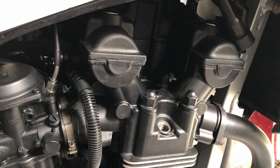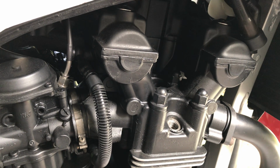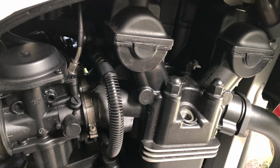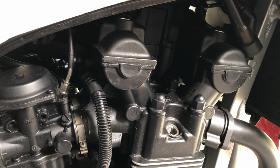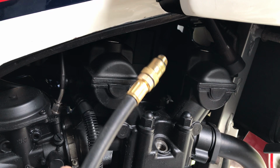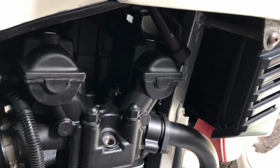Those piston rings were used for 22,000 kilometers, and that's my problem. The pressure test doesn't tell you where the leak is, but you can do a leak down test with the same sort of tool. But if you don't have that tool, you could just take the hose from the pressure tester and connect the compressor on the other end.